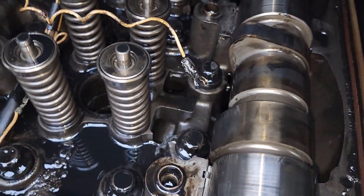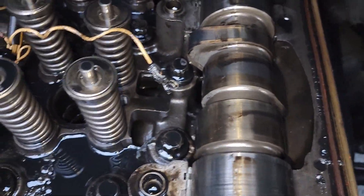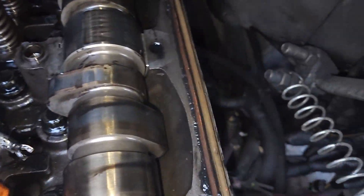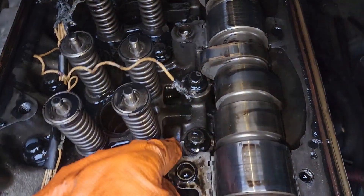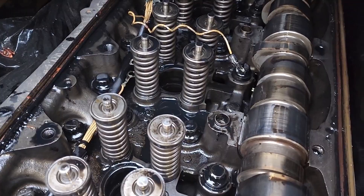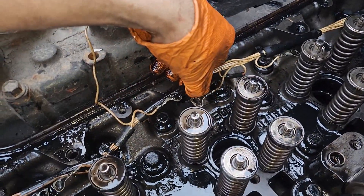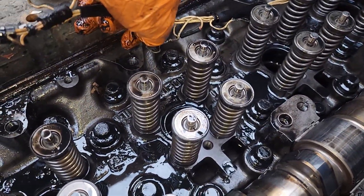I'll give it a couple more turns — we want this side facing that way — then it's basically a two-hand job. One hand on top of the ratchet wrench so it doesn't lean in towards the cam, and the other arm on the end pulling. It's a good workout for your left arm. I'll have to buy new cylinder head bolts — you're not supposed to reuse these. You could try reusing them but that's a little risky and you could completely waste your time. If anyone wants to leave a comment about reusing them, let me know.